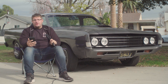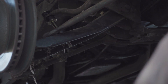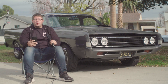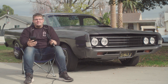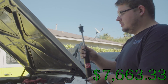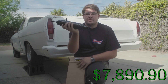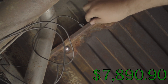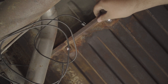Now it was time to start doing all the little things. I really wanted to tackle the suspension. I bought new shocks — I think the springs were cut from before, so I had to buy new front springs. I also had to buy new rear shocks. The rear shocks weren't even connected when I looked under the car, which is crazy. I drove that car a bunch with the shocks not even connected. The front shocks cost me $58.28. The springs cost $117 on the dot. The rear shocks cost $110.57. I went with air shocks for the rear to match the style of the old car, and so I could raise and lower it with more weight in the truck bed.